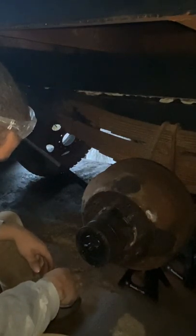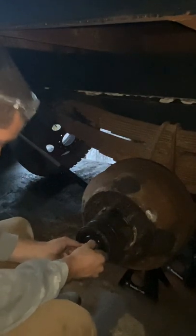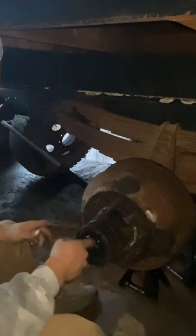Some kind of gasket sealer on the inside of it. Don't know if that's factory or from farm repairs. Okay. So here's where you need some kind of bolt to thread in there to really get that out. You have to take this out, and then that's when you have your axle nuts and all that good stuff. So we're going to go ahead and knock that out.